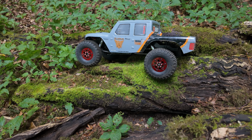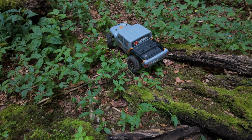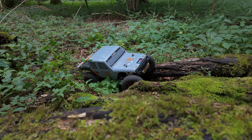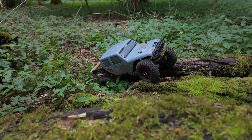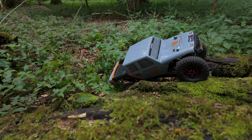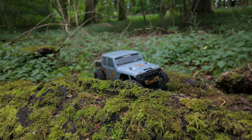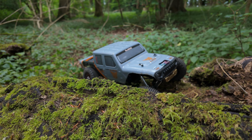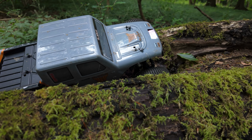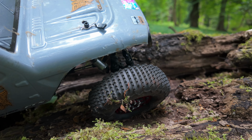So my concerns were that I would be losing stability in side hill. I was concerned over a little drop in the effect that weight has on the PSI of the tyre and insert combination. But as you can see from the video that you're watching, we're still getting plenty of squish on the Injora silicon cut blues. Incidentally, a cut blue is about the same as a green. There's very, very little difference between the two. When I was an early adopter of the silicon inserts, I thought the blues were too firm, so I cut them. But if I'd have maybe run the truck a couple of times, I would have very quickly realised that after they break in, they do soften up.